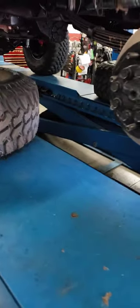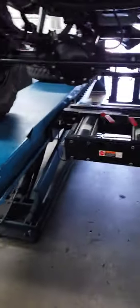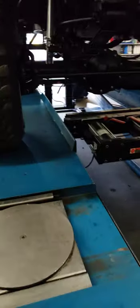If you don't have a lot of horsepower, you can build up the Dana 44 or GM Corporate 10-bolt — it's a very similar axle. You use most of the same stuff on them, and they're a very easy axle to get parts for. As far as off-road goes, if you're going up to 35s, I think three-quarter ton is good. If you're going bigger than that — 38s all the way up to 44s — you definitely at least want to be on a Dana 60 front axle.